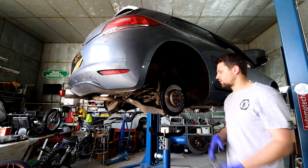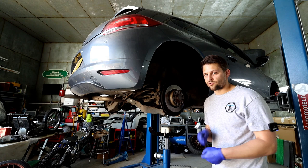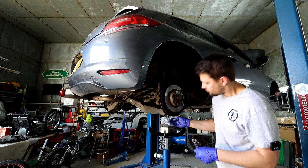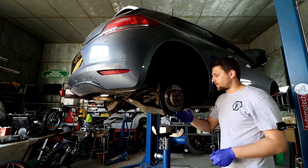I'm going to start on the rear ones first because there is something that can go wrong — the 18mm bolt that goes all the way through here can get seized, stuck, or snap. In most cases it's not going to happen, only with corrosion. The rear springs are easier and quicker to do as well. We're going to need an 18mm socket on one side and an 18mm spanner on the other side. If you're doing it on a lift, you'll need a transmission jack to support the arm because there's a lot of force in that spring.